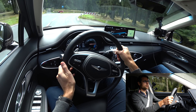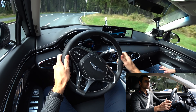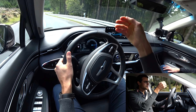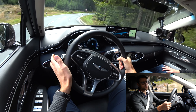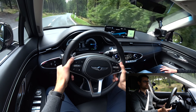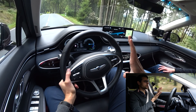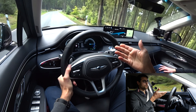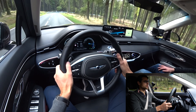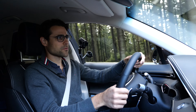The adaptive recuperation — when you press and hold the paddle — also adapts depending on if there's a car in front. When there's a car in front, there's recuperation; when there's no one in front, the car rolls. It's good that you can choose these modes and pick where you're most comfortable. I can control it without using my feet at this point. The energy consumption after high-speed motorway driving and going uphill went up quite a lot. Using stronger recuperation now going downhill, we'll gain back a lot of energy and then tell you more about the final real-world EV driving range.